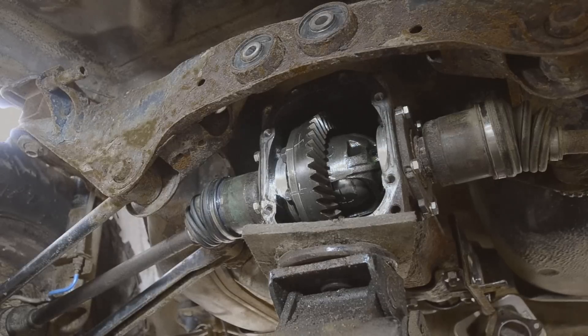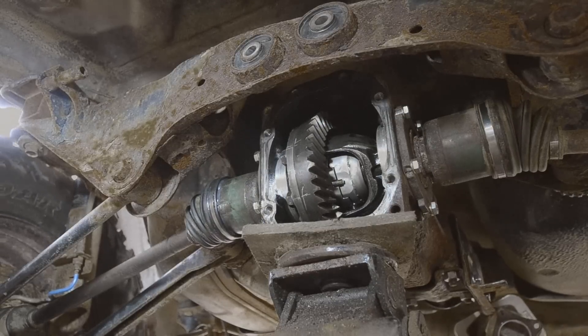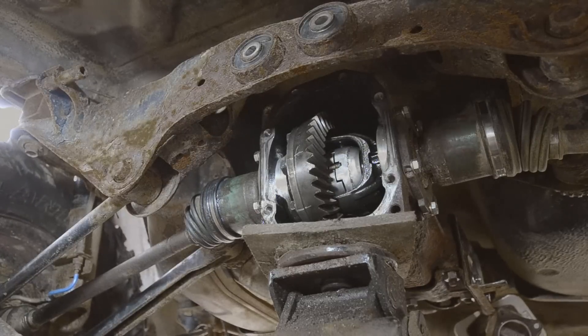So that's what the springs do, right? They provide a bit of biasing. Right there — the springs keep the thing so it's always just slightly locked. And so that's the force of that spring that you're overcoming to unlock it when you corner. So theoretically, potentially if you could put some lighter springs in there, you could make the ratcheting easier and quieter. Although I'm assuming Torquemaster has a good reason for choosing the spring strength they did.